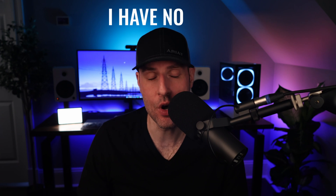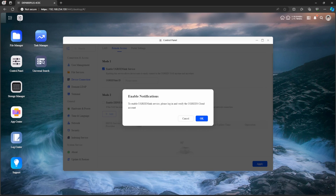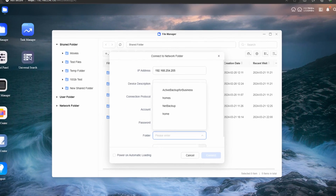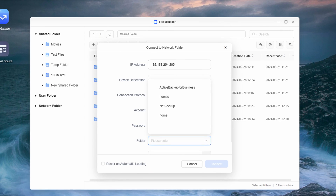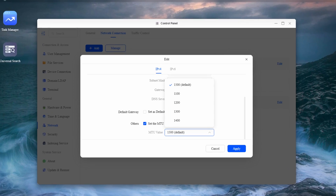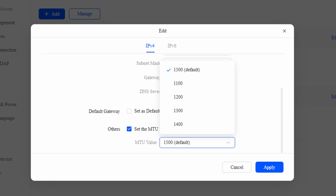I've been banging my head against the wall because the 10GbE doesn't seem to be stable, and it should be. There's also a bunch of other features like the uGreenLinks service, which is supposed to allow for remote access — but if SMB permissions aren't working, will you trust the uGreenLinks service to be secure? You shouldn't. There are other bugs like network folders that simply don't work — it doesn't show the information it's supposed to, and since a lot of the OS is filled with drop-down menus instead of free text boxes, there's no way to get it to work.